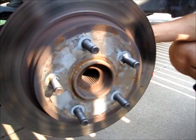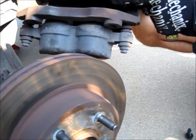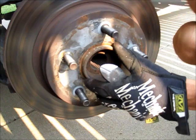Looking at the brakes themselves, the pads are almost completely gone — there's almost nothing left of the pad material, it's all backer. The pad is so worn that within maybe a month it would start to drag on the rotor and cause other problems. So we're going to do a brake job on this vehicle as well. There are three bolts that hold this center hub on from the back, so we're about to remove it.